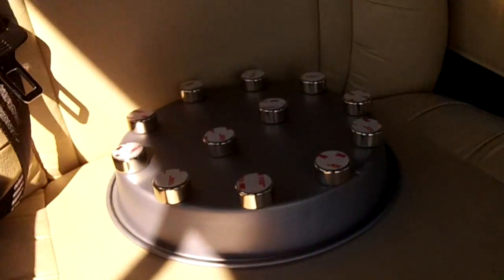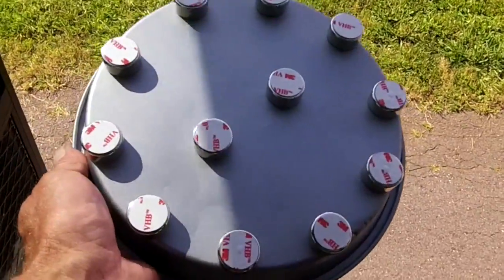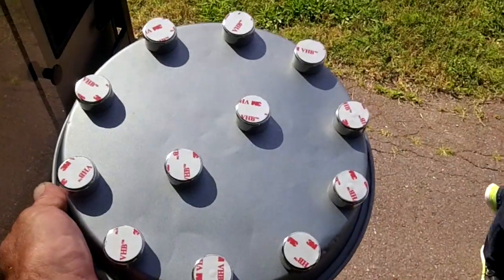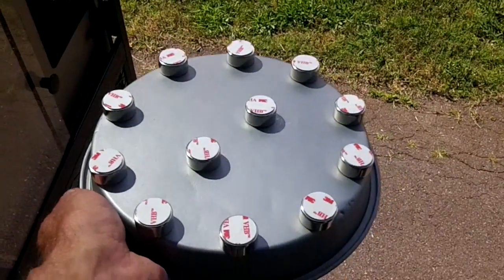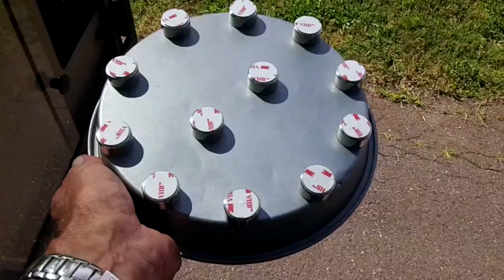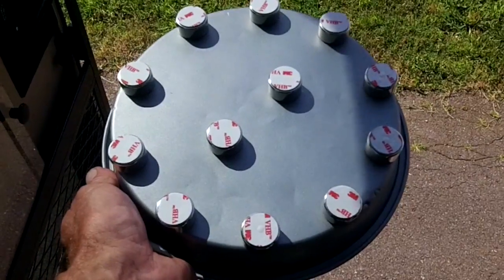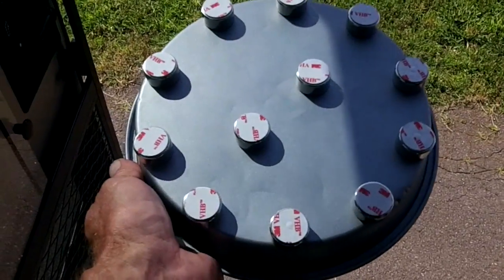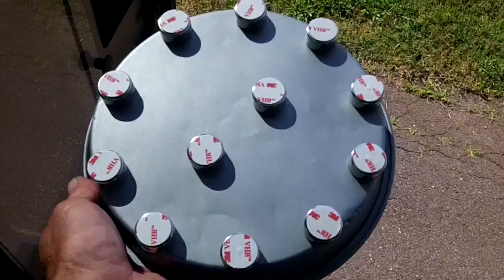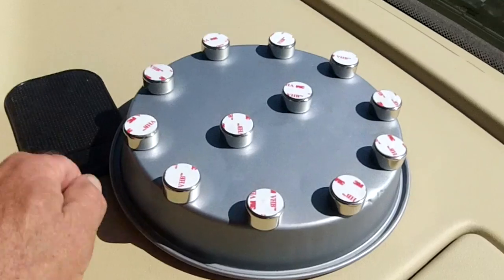And while we're in here, a little tip. When you receive your magnets, get this in the sun. When you receive your magnets, they're going to be in a roll separated by plastic spacers. What we do to make installation easier is separate the magnets one at a time and place them on the bottom of a cookie pan — a common household product you probably have. Whoever's installing the magnets on the inside can simply lay this on the dash and slide the magnets off one at a time. This will help ensure that you don't pinch your fingers between two of these magnets; they're very powerful, so you want to be careful.